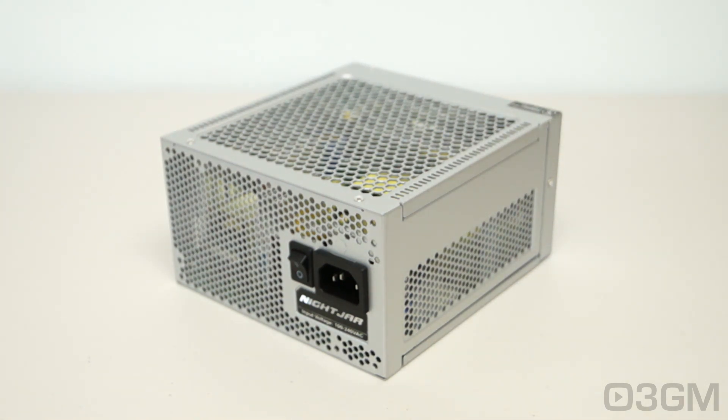This is not a gaming power supply. So how is this wattage determined? Well, to understand that, you need to know what rails are. Rails are basically well-regulated transformers which convert domestic current into the voltages that your computer system can use. There are essentially two different rails: a 3.3/5 volt rail and a 12 volt rail. In this particular case, the approximate maximum peak output of the 3.3/5 volt rail is 100 watts, and the 12 volt is 516 watts.